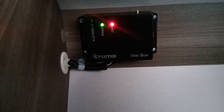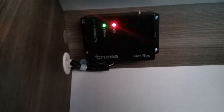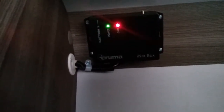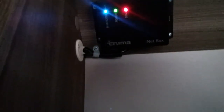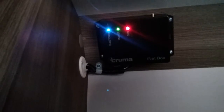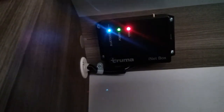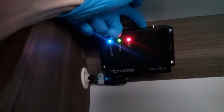This control panel can be linked to the Truma app. If you are going to do that, you need to use the box that's just located above the microwave. Once you've downloaded the app onto your device, you need to launch it and make sure that your Bluetooth is turned on. You'll see a button that says remote control — press that and then follow the on-screen instructions. It will firstly ask you to come to this box and press the Bluetooth button, which will send the signal out and you will then commence connecting up. Once connected, you'll be able to control your heating and hot water locally via Bluetooth. If you want to control it from much further afield, you can pop in a Pay As You Go SIM card just here and register that through the app.